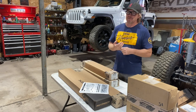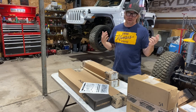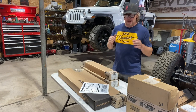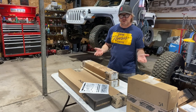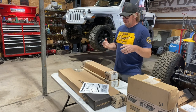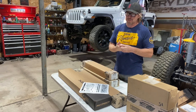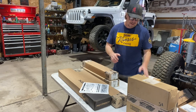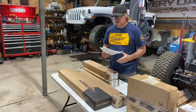John Curry has done a lot of amazing things in the off-road industry. He's been a competitive rock crawler, he's raced Ultra4 and won many times. I feel confident that his suspension will work really well on this little Jeep. It might actually lift it more than I like since this is a two-door and their suspension is kind of built for a four-door, so I might have to tweak the springs. What I really like are the Johnny Joint adjustable rod ends used on the suspension links — I've used those over the years in different projects. My first step is to lay out all of the suspension on the table, check the 38-page instruction manual, and make sure all the parts are here.